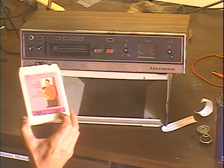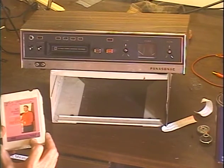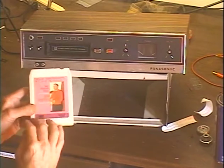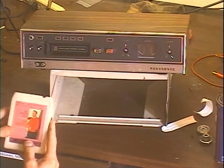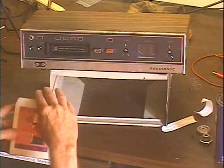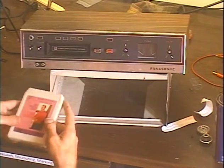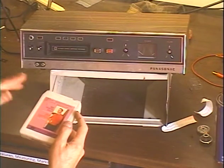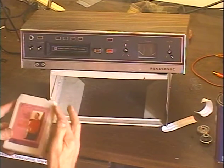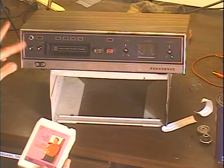It causes the tape to pack unevenly on the hub, and if you've got too much slack between where the tape goes back in and the outside of the reel, if there's any slack there, then pushing fast forward, it's going to make that capstan rotate really fast. It's going to turn the tape real fast. When you suddenly stop it, the momentum of the hub is going to keep feeding that tape through, but it's not being drawn back into the tape by the capstan. So that's where you're going to get a jam if you use fast forward.